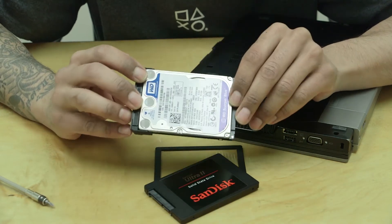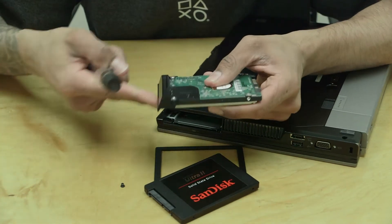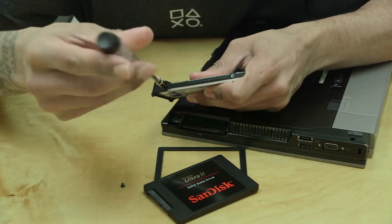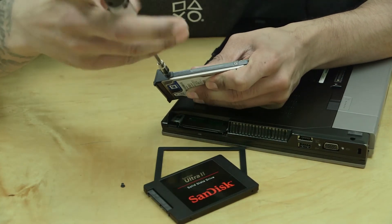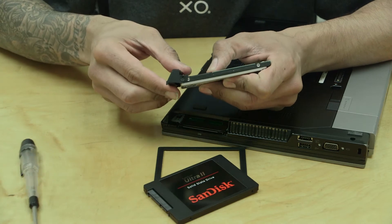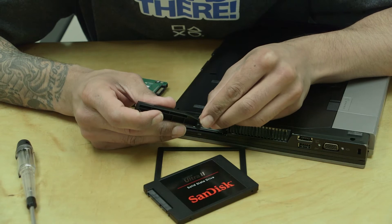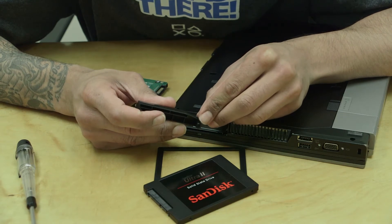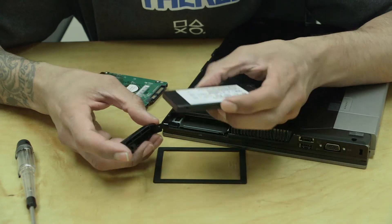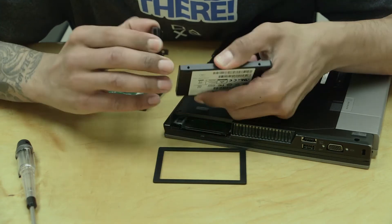On this little mechanism there's only one screw to take out — make sure you don't lose it, which is why I have the magnet. Then you easily take it off. When you remove it, make sure you don't pull hard because there's a little stick mechanism, and if that comes off the connector will be extremely loose.